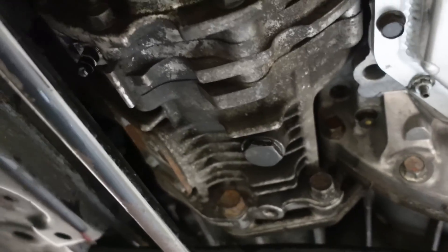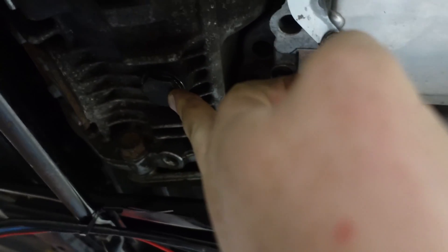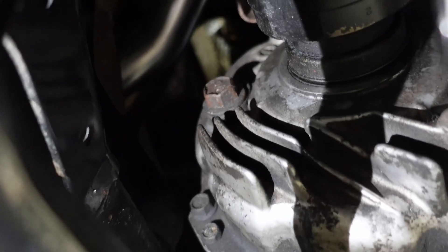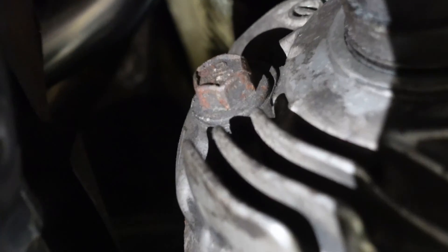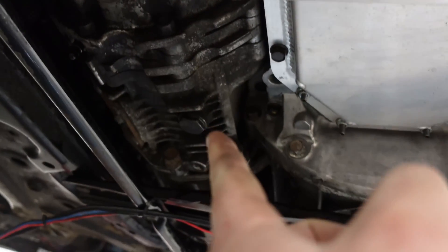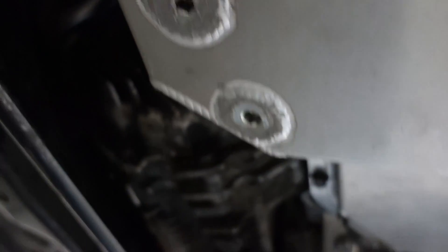Here we have the transfer case. If you look at the front of the car here, here we have the engine, and at the back is the transfer case. Now this big bolt here, that is your drain plug — you undo that to remove the oil out of the transfer case. If we follow the transfer case up here, there's a bolt there and if I zoom in, it actually says oil on the bolt. So that's a 17 mil and that's your fill bolt. In this case I don't need to drain the oil because it's already empty, so I'm going to take off that 17 mil bolt and then we're going to fill it with oil.